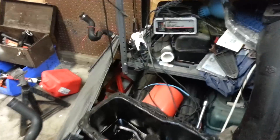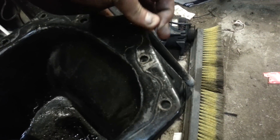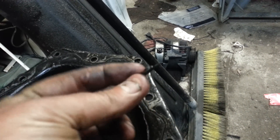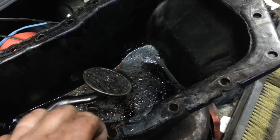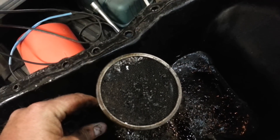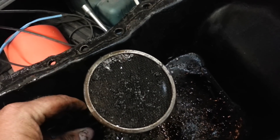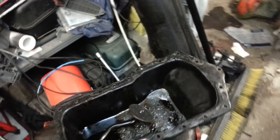The reason for this is somebody had had the oil pan off before and severely oversealed it. You can see all the crap that is down in here — this is all bearing material. Some of the silicone broke off free of the oil pan and went through the screen, through the oil pump, into the pressure release valve, and ended up starving the engine of oil.